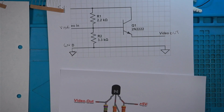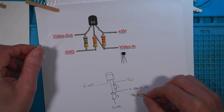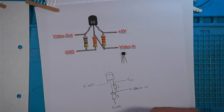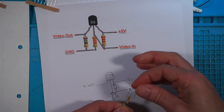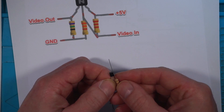I'm still a bit of a noob when it comes to this type of stuff. I'm going to try and do something like this little thing I've made up — stagger the resistors and perhaps put a bit of heat shrink on them, getting them as close to the transistor as I can, then cover them with heat shrink and make it as small as possible so it'll fit inside the modulator.